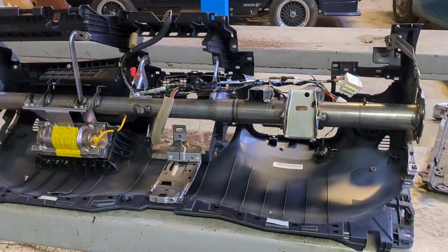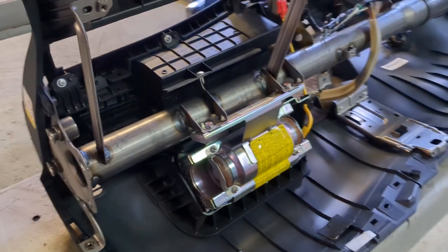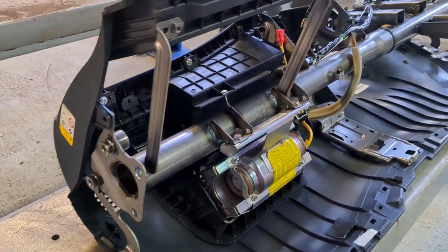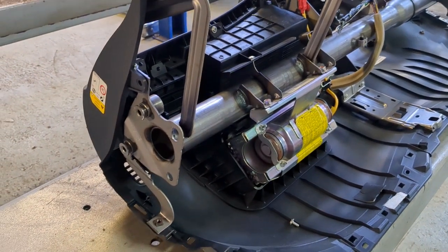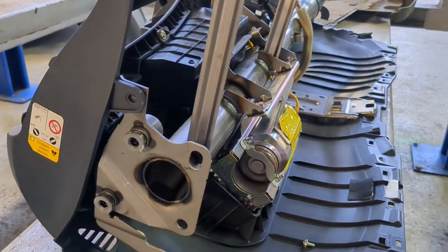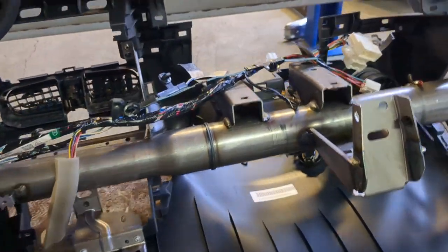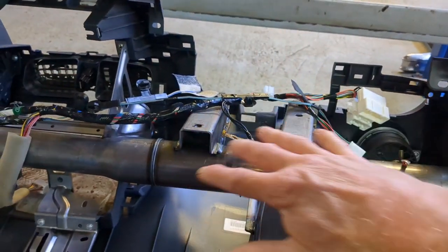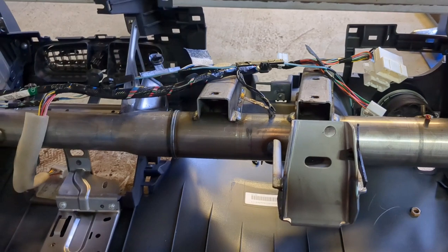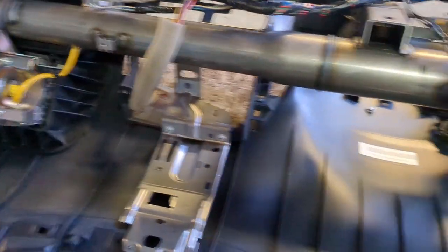Let's have a look at the dashboard. This is the inside of the dashboard — we've got airbags, and I think it's probably wise to take those out if we're rallying. That large tube across there is the main support structure, but it's actually a fairly thin bore tube with a thin wall, so there's not a huge amount of weight to be taken out of that. The assembly that holds the steering column up is quite important, so that stays. A few other bits — things that hold the stereo and all that sort of stuff — they can go.